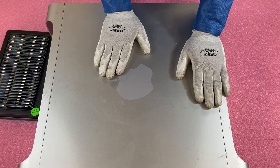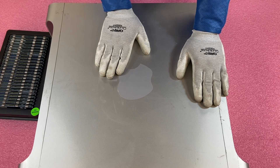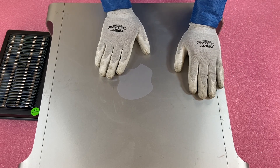Now that we have our ESD gear on, we're safe to open the machine. I realize most people at home do not have ESD gear — I totally get that. So what I recommend is two things. One, definitely don't open this up on carpet, especially old shaggy carpet, as it'll just attract ESD. Try to open it up on a desk. And before touching any of the parts inside, touch a piece of metal or copper to try to dissipate the electrostatic discharge on your hands.